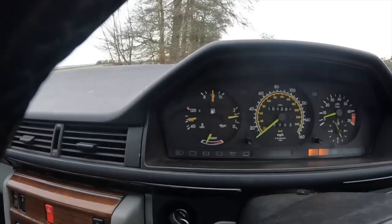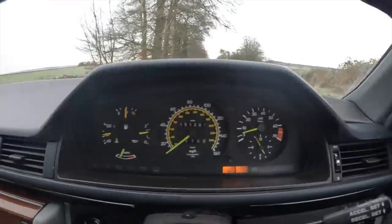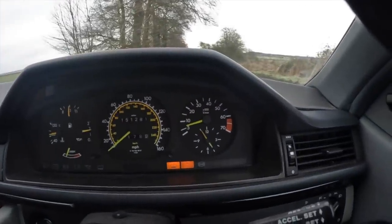Also in neutral, the economy meter should really be right at the bottom and it isn't — it's already a little bit further up the range. We don't think it's likely to be ignition related. I don't know if I can be bothered making a smoke machine to try and find the vacuum leak — I'm hoping to find it an easier way than that.